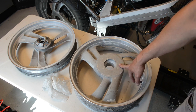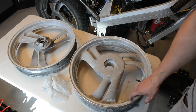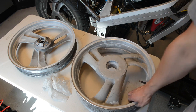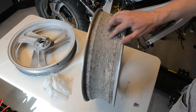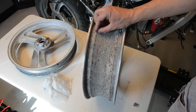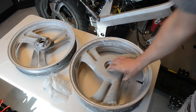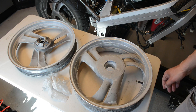I've ordered the tires and they'll be here in the next couple of days. I've wiped the wheels down with thinners so there are no contaminants. You'll also notice this residue — that's from those get-me-home kits, the stuff you spray in; it's basically liquid glue. It has no impact on the bike itself but as you can see that's the effect it has inside the tire. Once you put that in you might as well change the tire because the whole inside is wrecked.